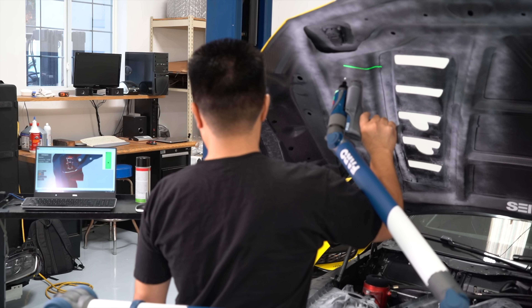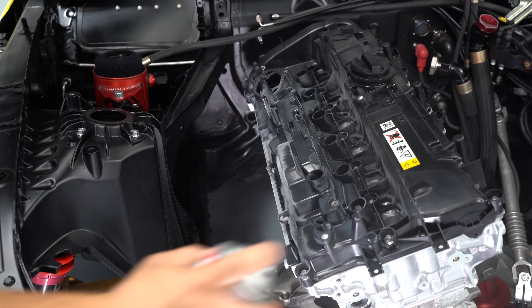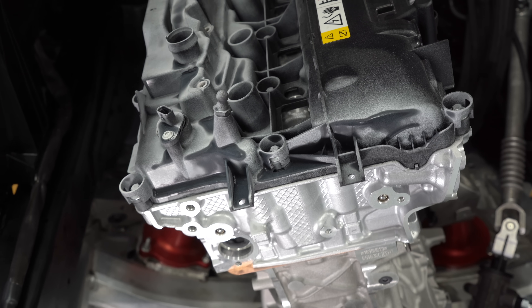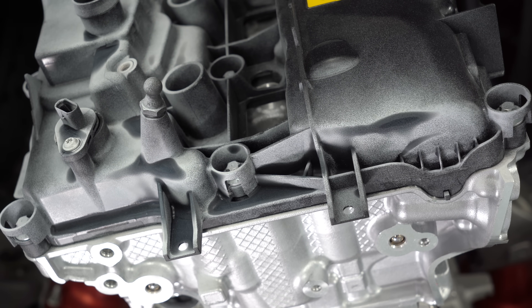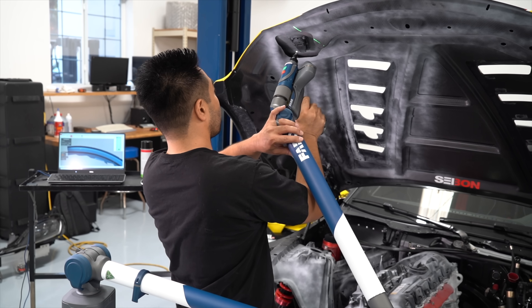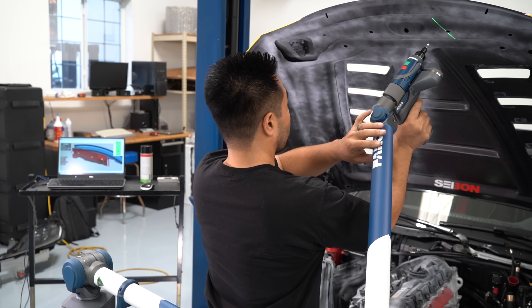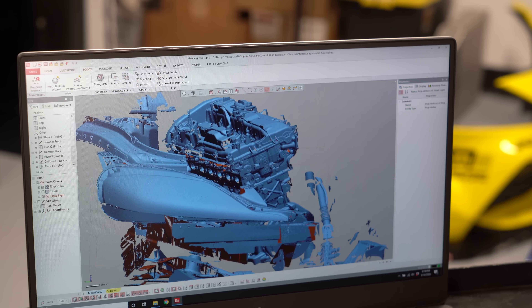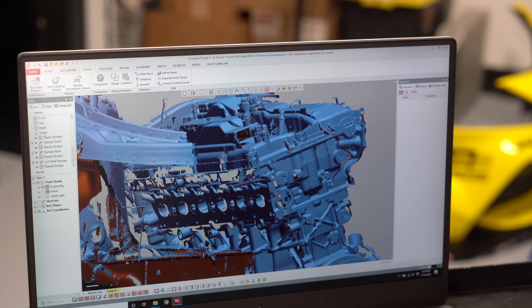For the scanning system to work properly it doesn't like shiny surfaces, so Tyler sprays a special chemical on all the parts he's going to scan to bring the shine down and make it more of a matte finish. You keep going back and forth with the tool and it continues to scan all areas the laser hits, essentially painting a picture inside the software until he's into all the different crevices and gets a very accurate model of the entire engine bay. It's all set up in different components — the engine, the headlight, the hood — and you can turn these things on and off as needed.